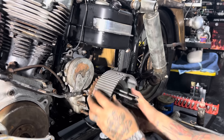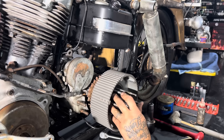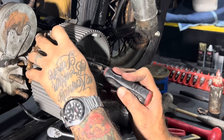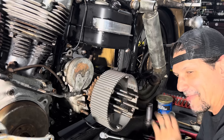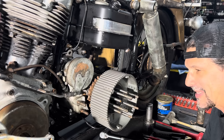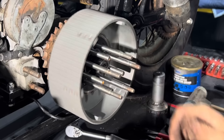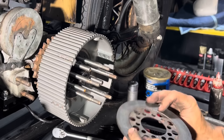It's not fully secured yet but it's already controlling the float of the clutch basket. You want a little bit of free float but not a lot - find the minimal amount and just expand the snap ring and push it down with a screwdriver to get it in there. If you've got a friend who's always having clutch problems with his four-speed, be a good friend and go buy him one of these kits. They're probably 10, 15, 20 bucks - worth every penny. You can see how I've got this in here now; it holds the basket in place and will solve a ton of clutch problems.